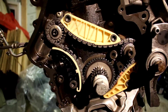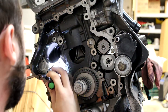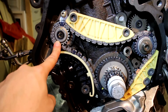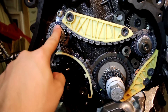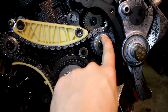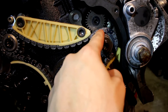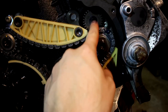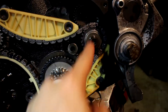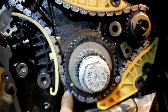Jumping ahead — got the plastic shroud in after all those struggles. On the exhaust side balance shaft there is the notch at around one o'clock and the respective colored link, then another colored link and that notch again at one o'clock. There's one dot on the balance shaft and two dots on the sprocket here and they have to mate together. Coming down here, that's the balance shaft timing link.